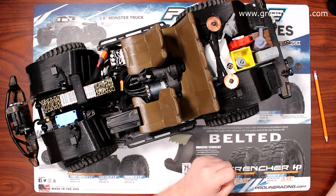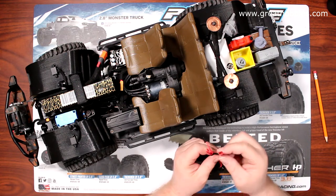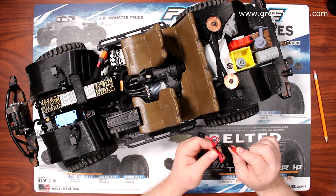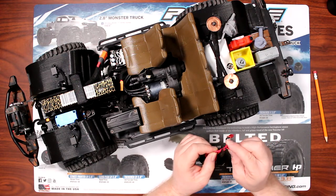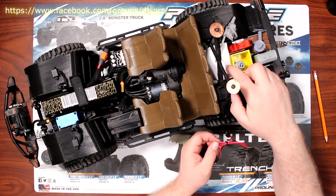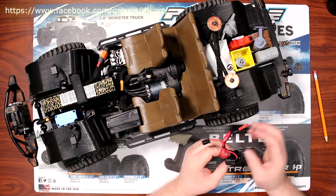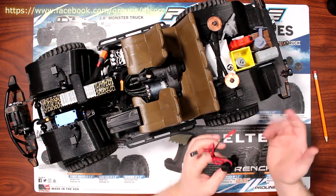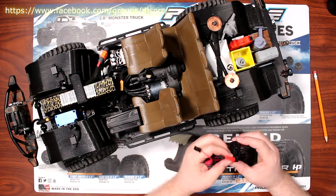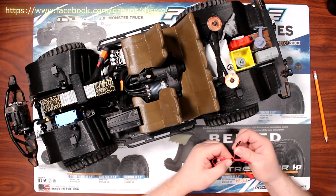Another thing I could have done is when you turn the vehicle on, the power supply gets power and activates the lights immediately from main voltage. Instead, I cut the signal wire in half and fed it through the receiver, but I put a switch in. This way, if I don't want them on during the day, I can just shut them off completely. The LEDs barely draw any current — it won't kill my battery — I just didn't want them on for nothing.